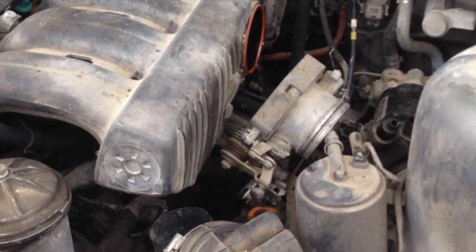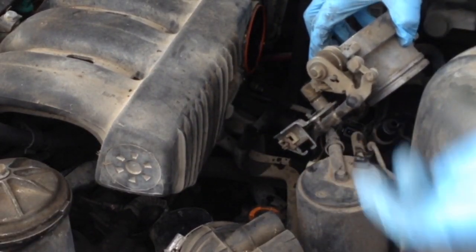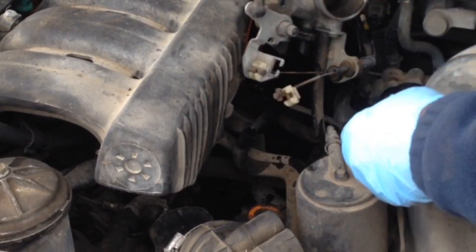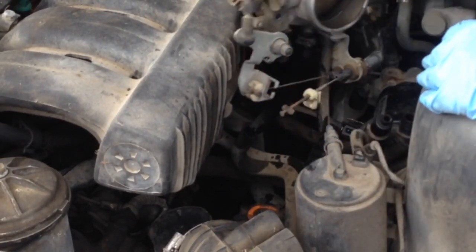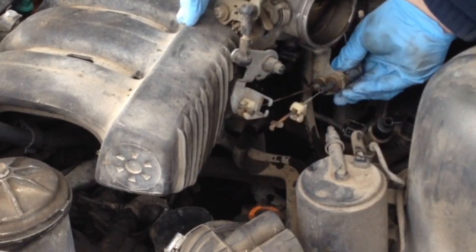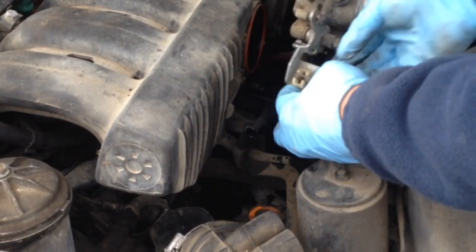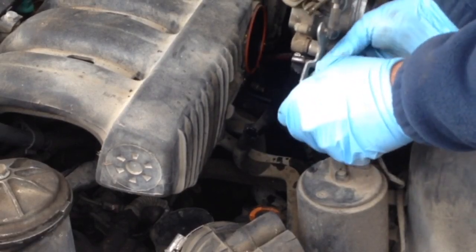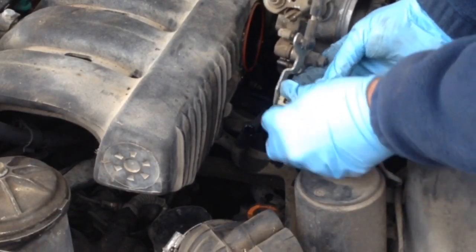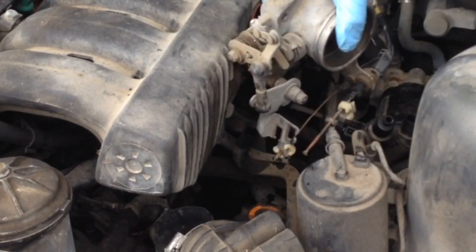Here's where we're at removing the throttle body. There are two hoses on the bottom - we just snipped them off because they're all dry and hard, we can't reuse them anyway, and this car is a parts car. How you take this off: it has little plastic threads back here and you grab it, thread those in to give it more slack, then squeeze the clips on the back and push this piece of plastic out. Just like that - once you do that you can slip it out of the holder and it's off.